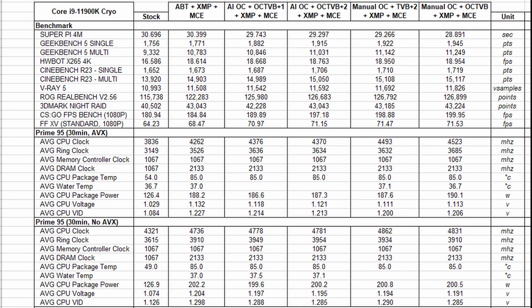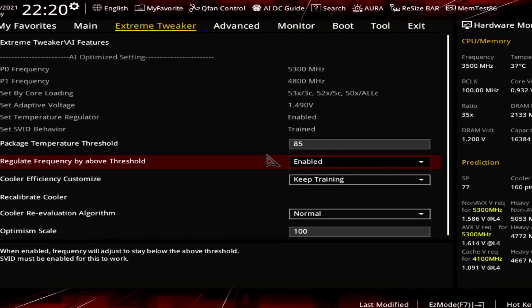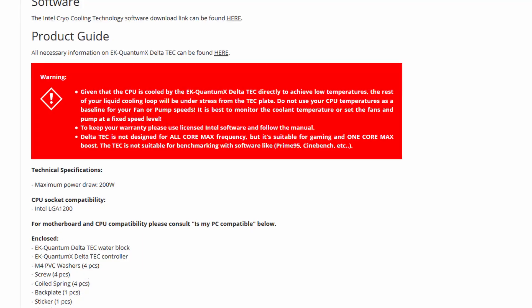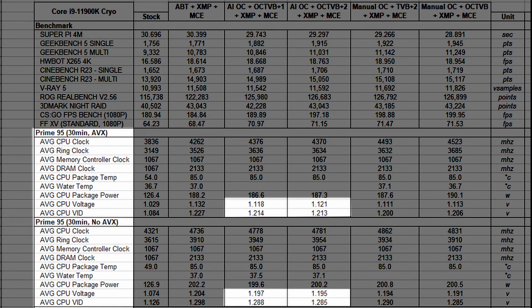As we have noticed from the two previous strategies, when pushing the CPU with Prime95, the average frequency is around 4.78 GHz without AVX and 4.37 GHz with AVX512. The limiting factor for this frequency is twofold: one, our configured CPU package temperature threshold of 85 degrees centigrade, and two, the maximum power draw of the Delta Tech, which is 200 watts. As the system dynamically adjusts the CPU frequency to fit within these parameters, we find that the maximum real-world CPU voltage for Prime95 small FFTs without AVX is around 1.29 volts, and for Prime95 small FFTs with AVX512 is around 1.21 volts.